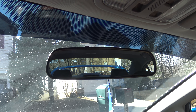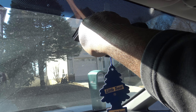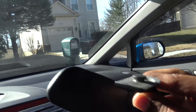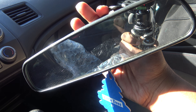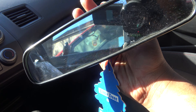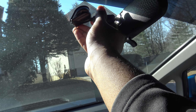To install — this is the mirror, I know y'all see that big wing in the back. Turn the mirror to the right, all the way to the right. After the mirror's turned to the right, then you grab it and turn the whole thing right, and then the mirror comes off — that easy. So out with the old. You guys could probably see better at the bottom of the mirror where it's fading right there. To install the new one, you stick it in sideways, get to the top, and then start twisting it.